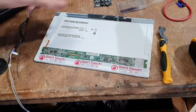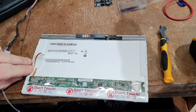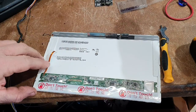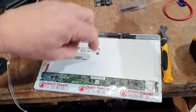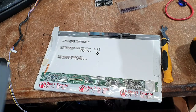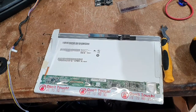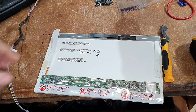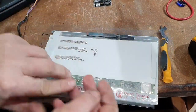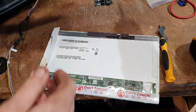I'm just pulling apart the back of the LCD display on an old computer screen. The strip I've just pulled down is the wires that go up to an LED - this controls the light for the actual screen. When you pull these things apart there are about three to four diffuser pieces; they diffuse the light and they're handy to make into a little cone type thing so you can put an LED in and make them look good.